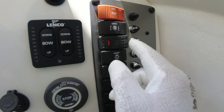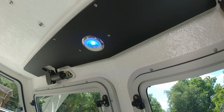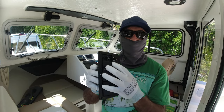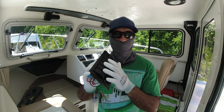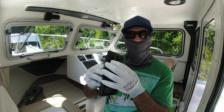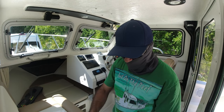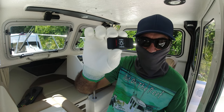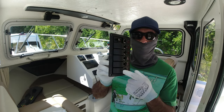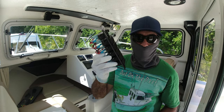Now I know it's this one right here — perfect. I've got my toggle switch back. The reason I didn't change the whole toggle switch is that the switch itself is still good — it's just the lid part that broke. Now I have this set because they will break again. The weakest point on this toggle switch is the lid — the moving part. They do break all the time, so I'm going to keep this as spare. I have the stickers to label the switches when they break. What I like about the factory one is that it has a very good label, but we don't want to go to the factory because it's going to cost an arm and a leg. Getting this inexpensive set is perfect — if any of the rocker switch lids fail, I've got spare parts.